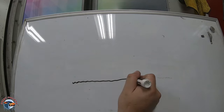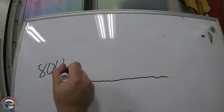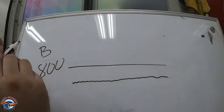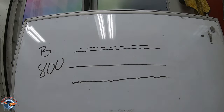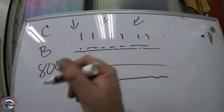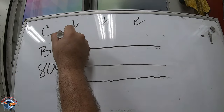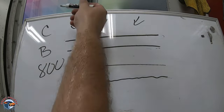Let's mimic our actual finish — this is orange peel on an OEM panel; it's not perfectly flat. When you come in on a blend panel and you're flattening it out 100%, you see how nice and smooth that is, and our base coat will go on nice and smooth. But if you did not lay down your base smooth because you're spraying with the wrong reducer or you're not being clean, your base coat looks bumpy again. What happens when you spray your clear? Your clear is only going to show you what your base coat looks like. If your base coat was dirty, your clear coat will be dirty. If your base coat goes down smooth because you're clean and using the right reducers, your clear coat will go on smooth as well. A good clear coat finish happens way before it comes to spraying clear.